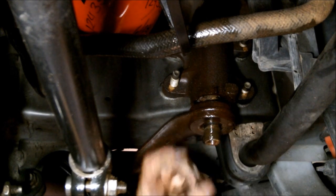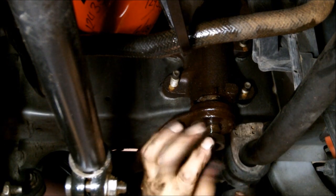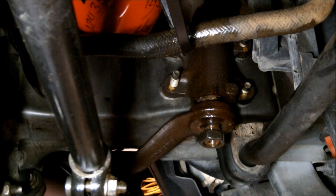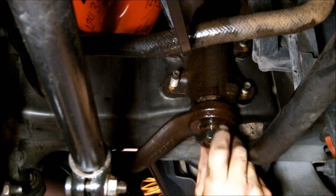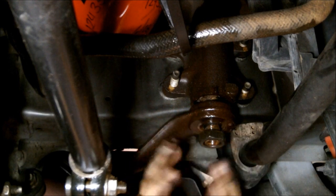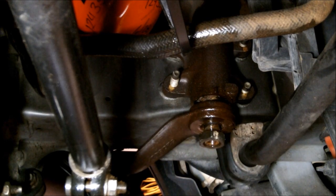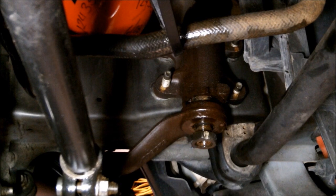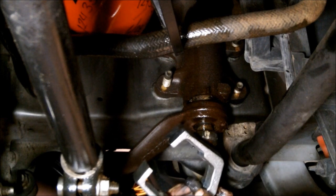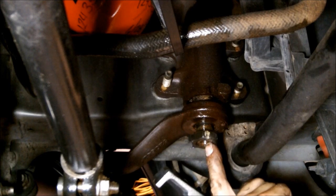What I would recommend: I got the lock washer here, you can go ahead and take that off, but what I would do is put the nut back on. Because when this thing pops off, it's going to come flying down and smack you right in the face — not a good thing. So leave the nut on, put the puller on here. It's going to pop up to the nut, and after that it's loose and you can take the nut off and pull the Pitman arm up. I got my Pitman arm puller here — you can pick these up at Harbor Freight for around $10.